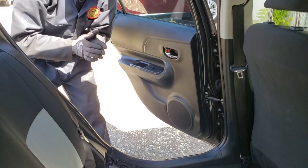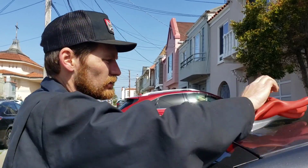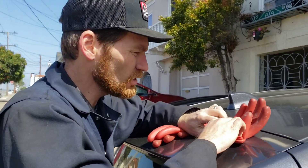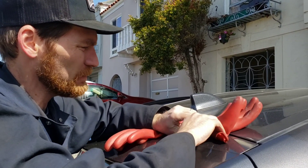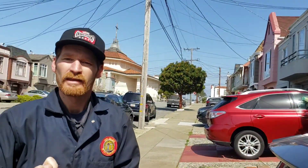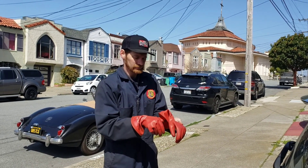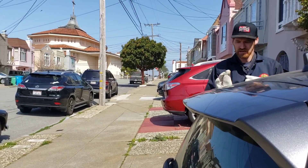I'm going to test my high voltage safety gloves and put them on. I'll undo the cover and then undo the high voltage positive and negative wires. I'm just making sure there are no holes in them — rolling each one up and ensuring there are no holes. These are good. Now I'm going to put the leather over-gloves on top of these, which serve to protect the gloves from being cut. These gloves are about $80 so you don't really want to tear them up.